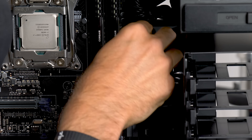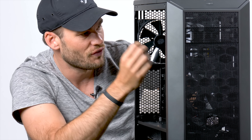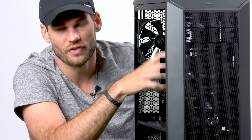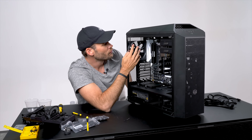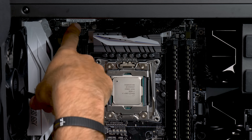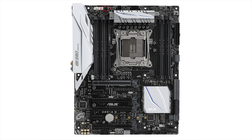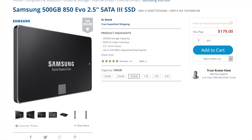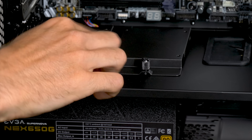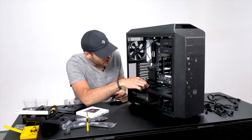To put these in we're just going to slide these little arms back on each of the slots we're going to use. Notice there is a small little tooth here — we want to make sure that we line that up with the tooth on the motherboard. Put in one side and then just snap the other side down; when we push down the little arm will come up and hold it in place. Now that we have the processor and RAM in place, I'm going to get all the cables and back plate out and start installing this motherboard into the case itself.